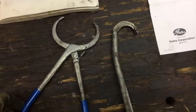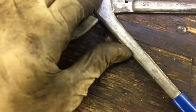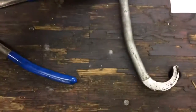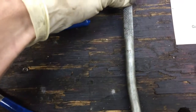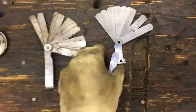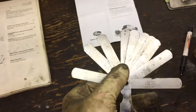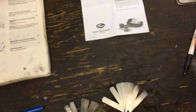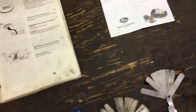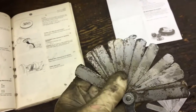These are the tools you will need. This one is to remove the shim and it is Volvo part number 5195. This one is to depress the valves and it's Volvo 5196. You'll also need feeler gauges. These ones are in pretty good shape but unfortunately they only go to about 15 or 16 as the maximum width, and when we're checking the exhaust we need to get up to the thirties and forties. So I have this set — it's a little bit rusty but it should do to measure the larger gaps.